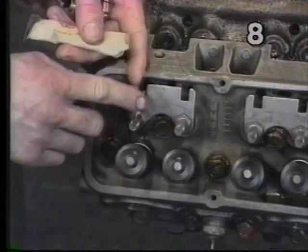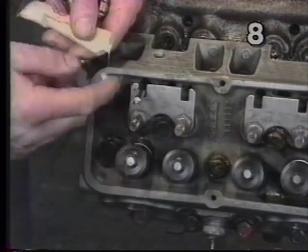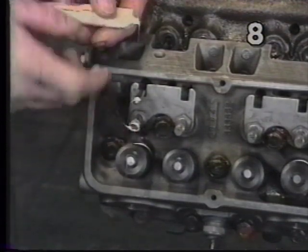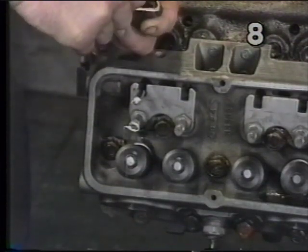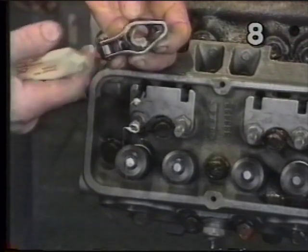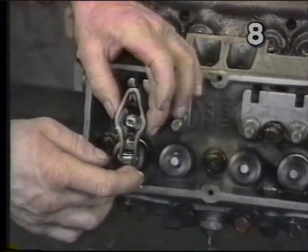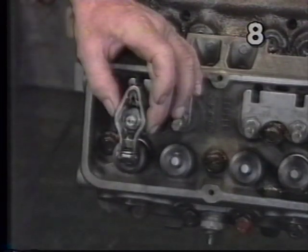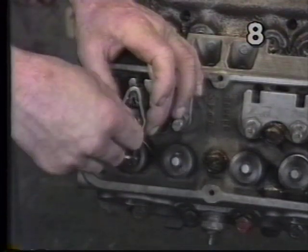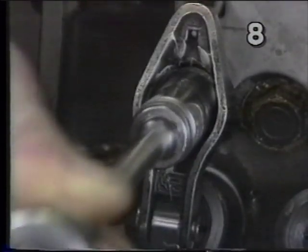At this time we want to put a generous amount of lube on the end of our push rod, on our valve stem, on our rocker arm stud threads, and a good coating in the area where our pivot ball will make contact. The reason we've lubricated the threads is because this type of rocker arm comes with what they call an interference nut. We can continue now to tighten this nut, watching the lifter until that plunger just starts to move down.